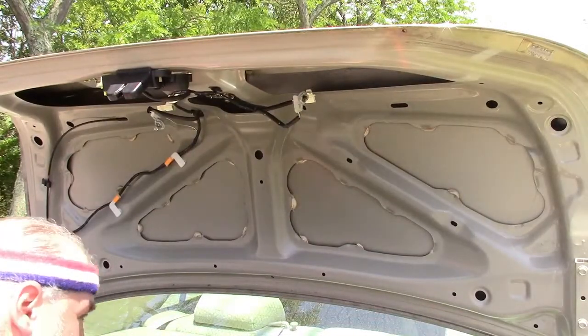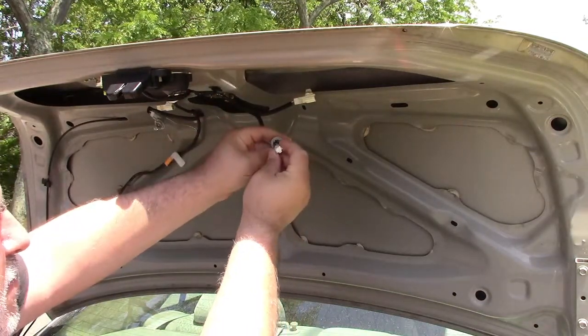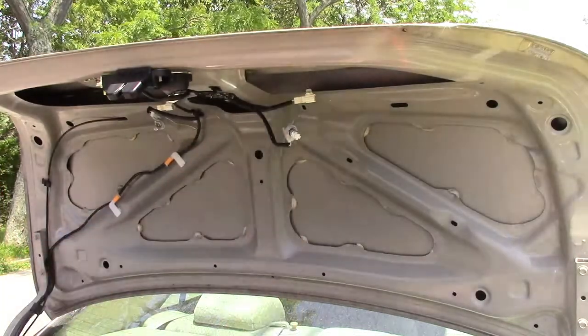I'm replacing mine with LED bulbs. Not all LED bulbs are non-polarity, so make sure to check the specifications of your bulb. If your bulbs have a polarity, you have a 50-50 shot of getting it right the first time — if it doesn't work, take the bulb out, rotate it 180 degrees, and plug it back in. If you're replacing your bulbs with new incandescents, polarity does not matter. These particular bulbs are going to go in exactly the same way regardless — they're non-polarity, so they just push right in like that.